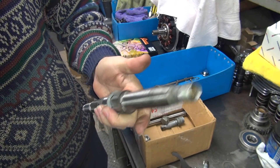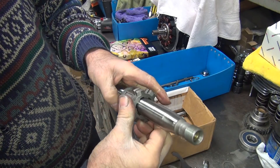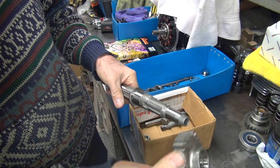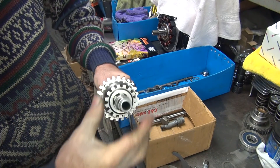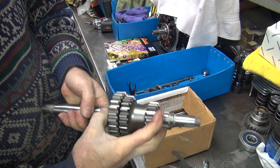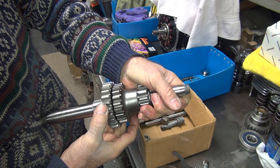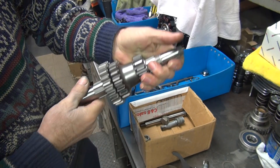Once it's on like that, then you've got the shift clutch dog right here — stick it on and slide it right down. Now you can assemble everything backwards like this. If you put this in a hydraulic press to put pressure on it, you can see exactly what your end-play is. In this case, everything's pretty loose so you can check it easily. I told you there'd be quite a bit of end-play — that's a lot, that's more than you really need and can cause some issues.